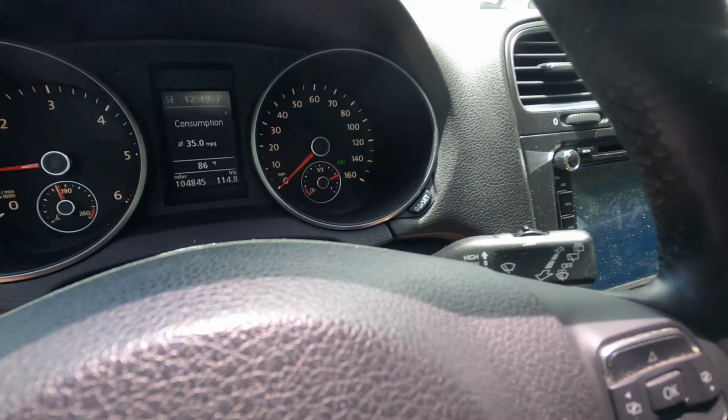All right, so to wrap this all up, it's now a couple of days later. I wanted to give it time just to make sure the lights didn't come back on, and guess what? Not a single light on the dashboard there. I also went ahead and replaced the two LED bulbs that I had put in for the license plate lights with regular incandescent 194 bulbs. So after replacing the license plate lights, all of the lights on the dashboard are out now.